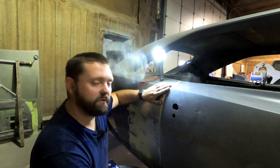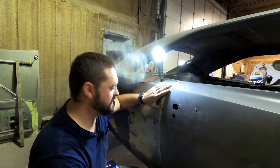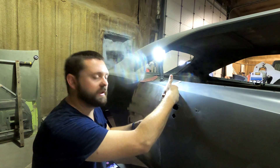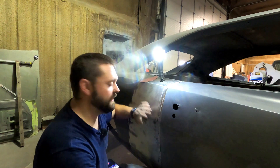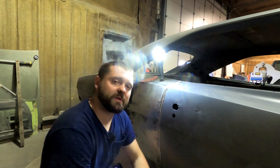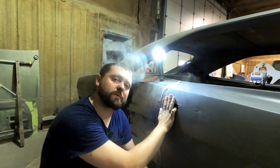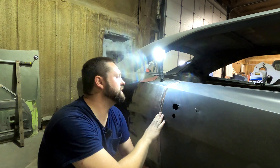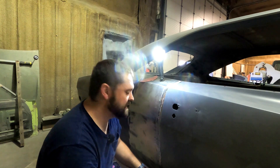It's always been kind of the worst fitting quarter that I've had and the biggest problem child of this car. We did do a bunch of cutting to get the door to fit. This door closes and opens perfectly other than the hinges getting a little squeaky — they're new. A big issue is right from this body line to this body line — it's really tucked in. We're going to have to slice it, bend it up, and then weld the seam in there. It's something I've just kind of been putting off. So we're going to have it as a fast forward and address this whole door, get the gap tool in here and just get it real perfect.